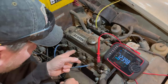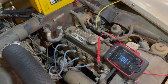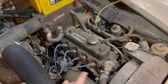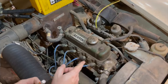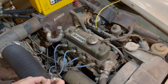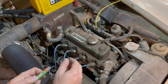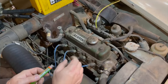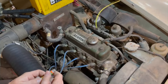So if the distributor is working — you can see the float valve is stuck on that carb and it's leaking all over the place. For now, I'm going to let the carb sit with fuel filled in it. You'd be surprised at how many things can be fixed if you just drive your car once in a while or even fill the carburetors with fuel. The gasket starts to swell back up again, and it's good to let the valve sit in fuel. We'll check back and see if it works better once it's been exposed to fuel for a while.